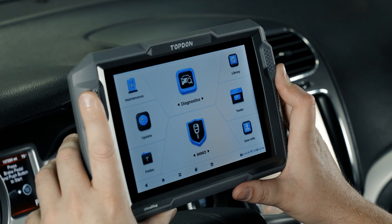Now we have the option to go into any of the communicated modules to look at live data or perform other functions. We're going to look at the PCM for demonstration. The PCM menu on this vehicle has misfire data, special functions, system check function, configuration (needed when a new or used module is installed), active test for bi-directional controls, data stream, DTCs to read and clear, and ECU info to verify specific details about the control unit. Some modules will have these options and some will not.